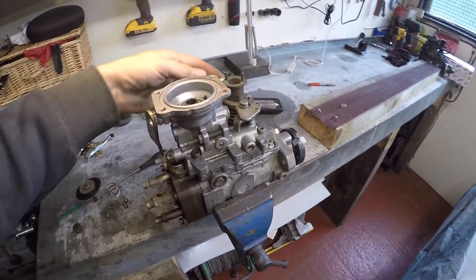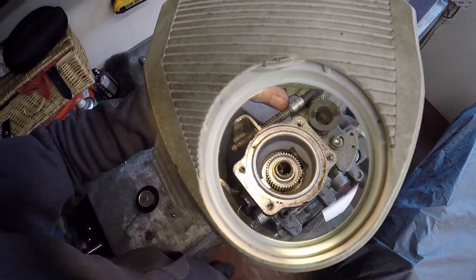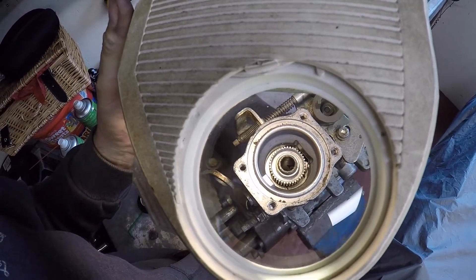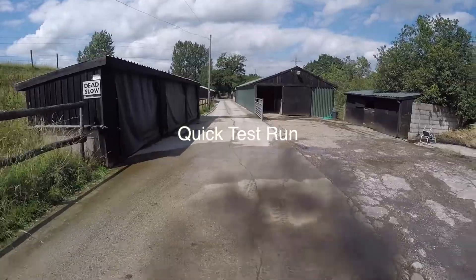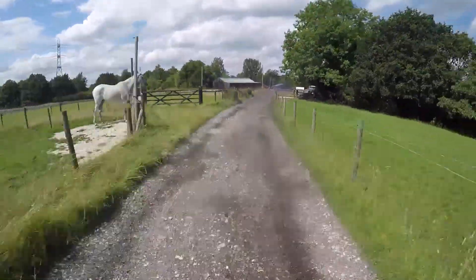One tip: if you're working on it and you accidentally engage the throttle, the fuel pin will pop out. If it does pop out you won't be able to put the diaphragm back in again, so you need to get a screwdriver in and pop the fuel pin back in — otherwise the diaphragm won't go back in. So bear that in mind. That's it — an easy way of modifying your 200 and 300 TDI Discos and Defenders. A simple way of doing it without getting too technical. Thanks for watching, catch you on the next one.